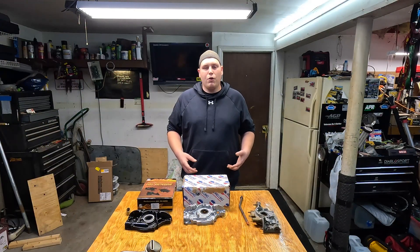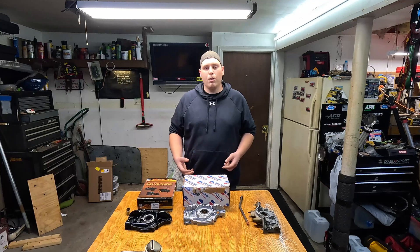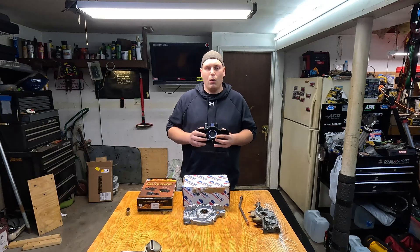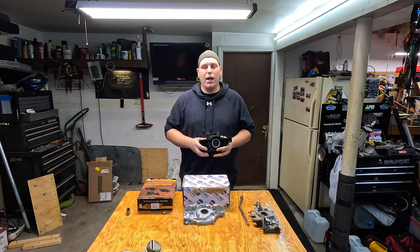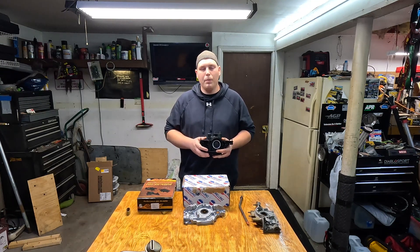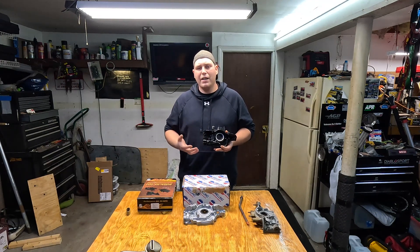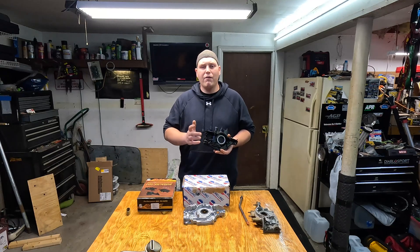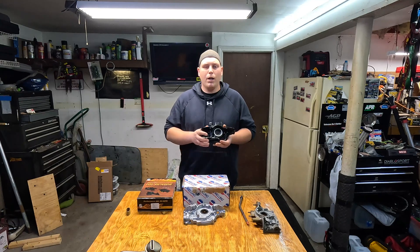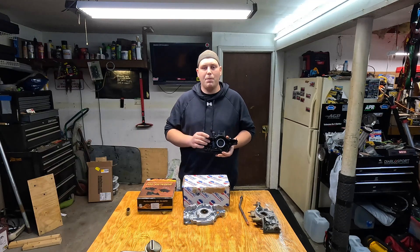Now that we've gone over a few of the different oil pump options, the question still remains: which oil pump did we decide to use for our new turbo build? Well, I decided to go with the ACL Race Series D16 Z6 oil pump. Now I'm sure a bunch of you guys are probably like, didn't you just say that there's no dipstick slot in the Z6 oil pump? Yes, that is correct — there is no spot for me to put a dipstick in the Z6 pump like the factory Y8 pump would have, but I've got an idea on how we can try to get around that. So we're going to roll out our engine, mock up the new pump and the new pan, and then I'll show you guys how I think we can get around the not having a dipstick issue.